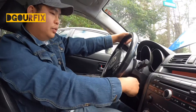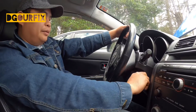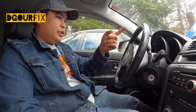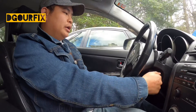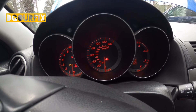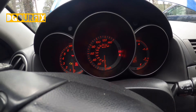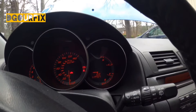Let's try cranking it — one, two, three, four, five. I can hear the fuel pump pumping fuel to the engine, but it won't crank. If you try to start it, you can see the key warning light flashing on the dash. When we turn the ignition on, that key light comes on. This is actually a good car — it only has 117,000 miles on it.